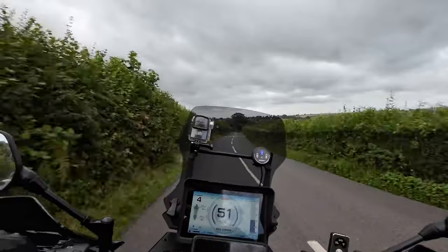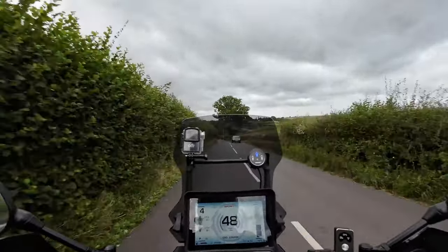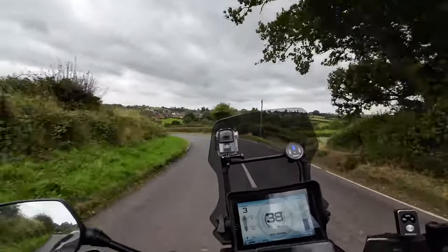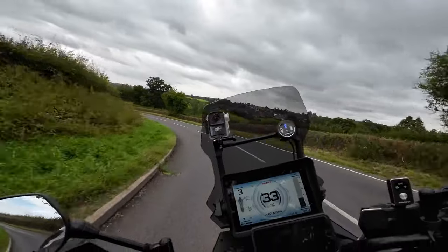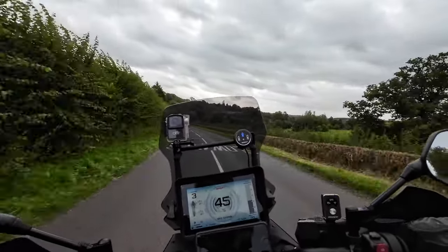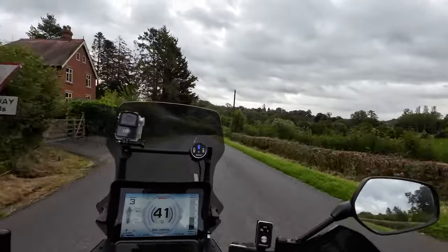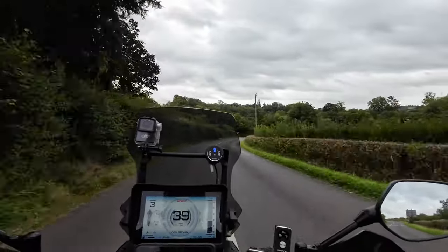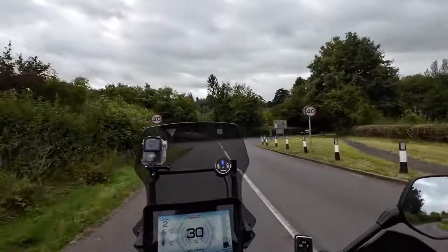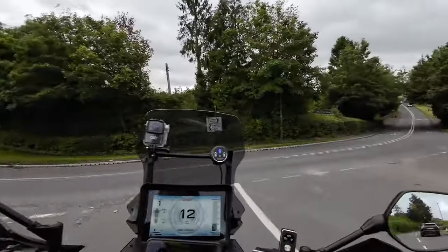Obviously then, set your chain. Make sure your wheel's level and your bike. Set your chain. I set mine to 50 mil on the centre stand. And that's it. It ain't a hard job to do, but without a gear puller, you've got absolutely no chance.